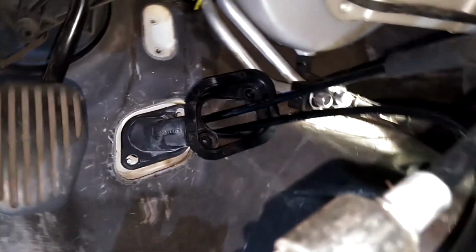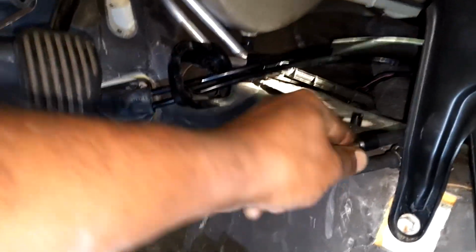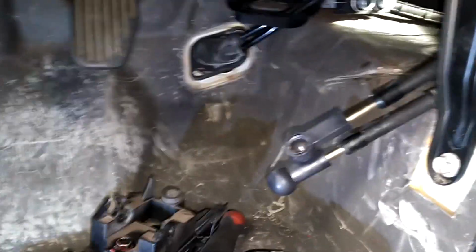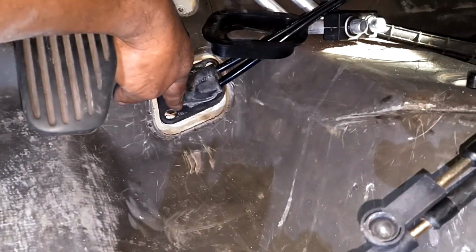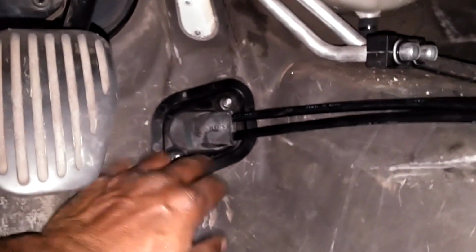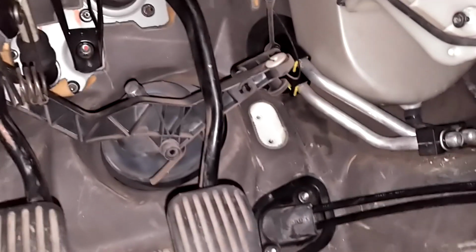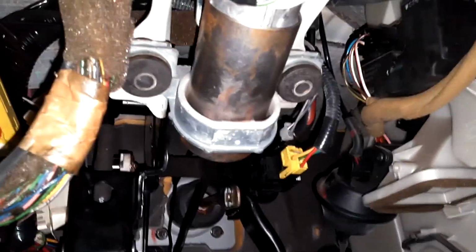Not quite falling in place there where I wanted to. So this one with the yellow, I'm gonna go ahead and tuck these cables over and twist them so I can guide them through those 2 holes. The yellow one comes through this hole, the other one goes through that hole, and then that'll fall in place easier to put that trim piece on and snug those 10 millimeter nuts on there. So there it is, 2 10 millimeters in, the plastic's pulled across there, the cables are pulled through the center console area. I'm gonna go ahead and put the gas pedal, accelerator pedal back on, and then I'm gonna secure the bottom of this steering yoke.